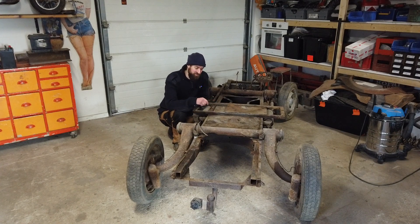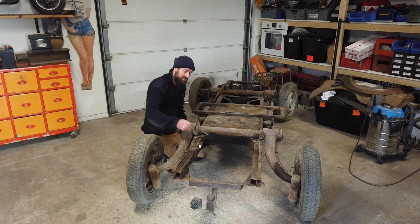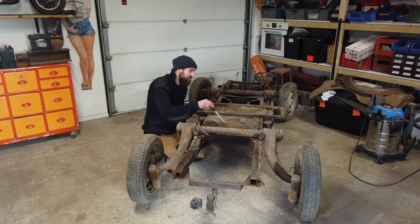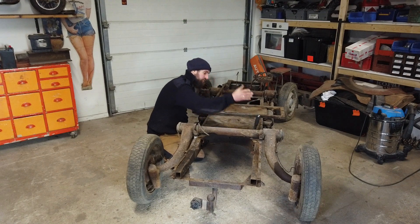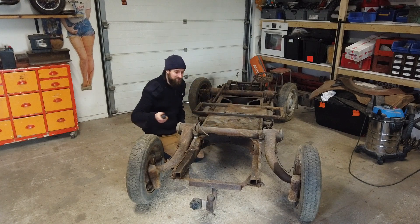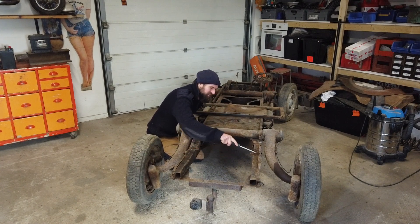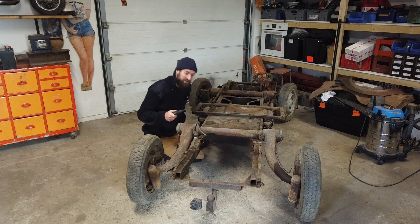I have found some more rust. For instance, I can stab a screwdriver inside the leg back there — it's not that bad, but that's one spot. Another spot is where the space frame rests on the frame of the Mahari. It's really thin; you can actually go through it in some places. Again, it's not a really big deal, it's easy to fix. The folded-over edges are in some places really swollen up, which is normally caused by rust, so they have to be folded up, fixed, and then folded back. Again, not a huge deal, but another deal.